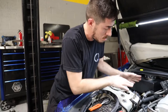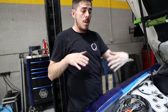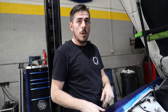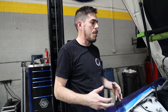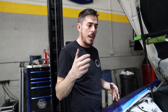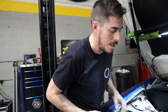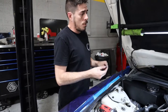Next work on the drain line. There are all kinds of ways to route it — you want it going under the car, not draining on top of the plastic panel underneath. Find a hole in the panel, or if your panel is gone (they like to fly off these cars) just route it so you can drain directly into a bucket or an approved section of the track. Never drain your tank in the staging lanes — you'll ruin somebody's day. Drain into a bucket so you can dispose of it properly.